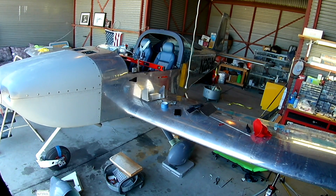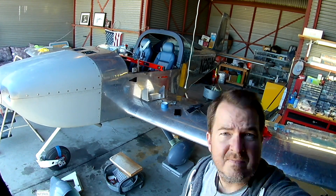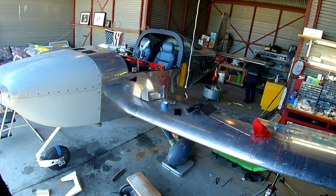The idea behind putting it in this orientation is you need that front wheel to be basically floating as though you're flying. When you line up this front fairing, the idea is that as you're flying you want that fairing to be in the same orientation as the two mains. When the mains are off the ground they droop down towards the center, and when the front nose tire is off the ground it droops down too, as you saw when we jacked the plane up. So this is what we have to do to make sure we've lined it up properly.